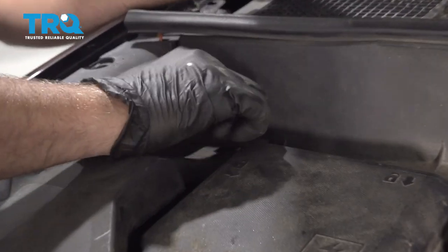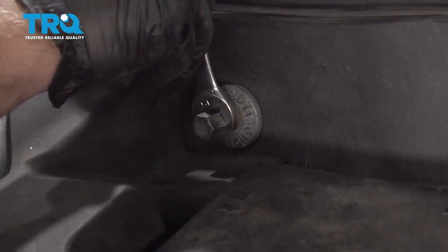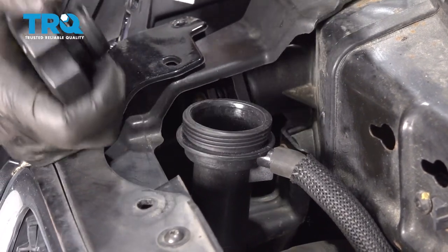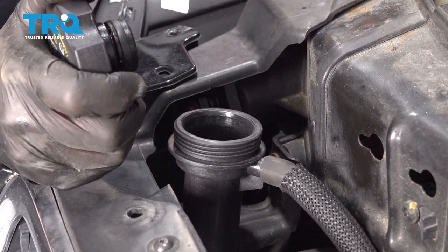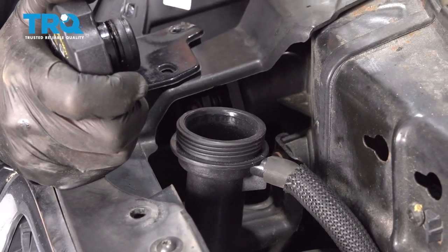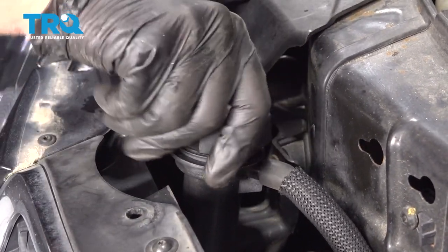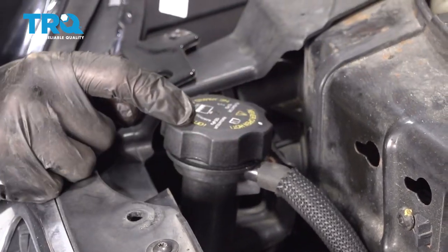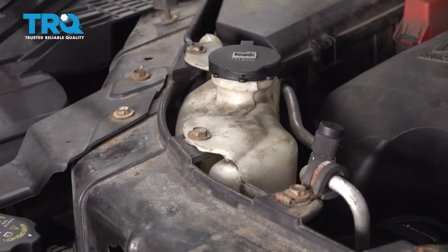Install this ground terminal and snug it down. At this point, add your coolant — check your owner's manual for the proper mixture and the proper coolant type. Run the engine for about 10 minutes, monitoring to make sure the engine doesn't overheat. When the engine is up to operating temperature, shut the vehicle down and let it cool. Adjust the level once it's cool and put the cap back on. Double-check the reservoir, adjust accordingly, then take it for a road test and double-check afterwards.